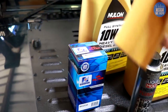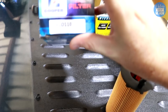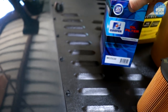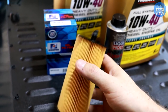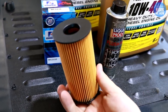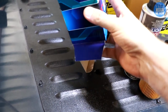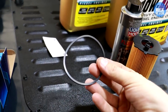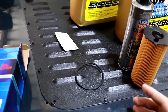We're going to need a brand new oil filter. The number that you are after is a WCO110. You can see they have a little nipple on the top — that's the locator that needs to sit into the bottom of the actual cartridge itself when we put it in. In the box you will have a new oil o-ring, and that's effectively what seals the lid of the cartridge holder, making sure you don't get oil everywhere in your engine bay.